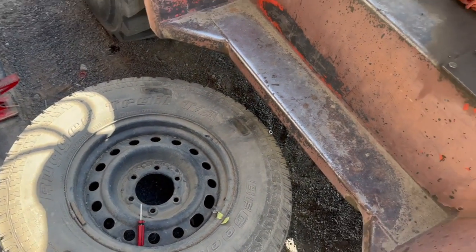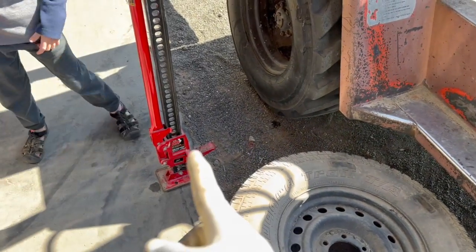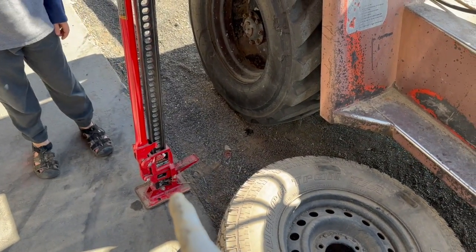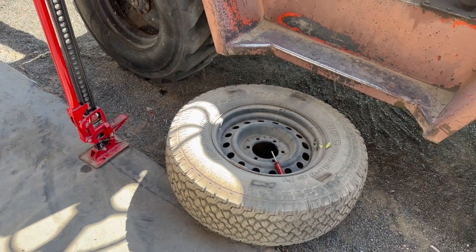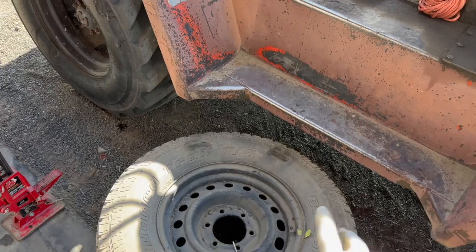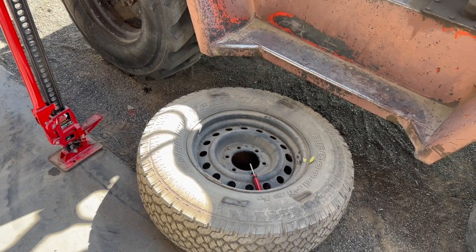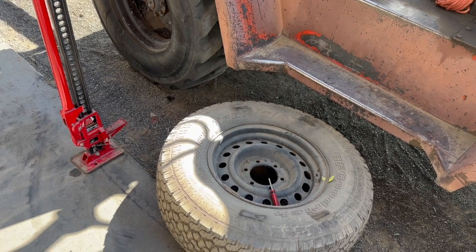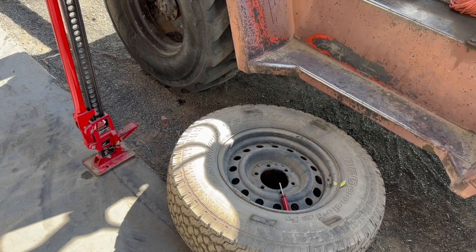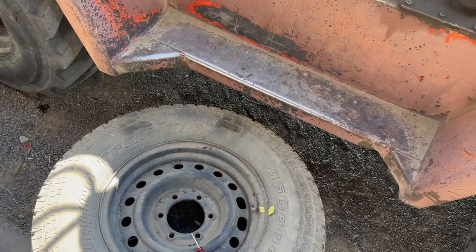For this process I am using a forklift from the farm — a high lift mount — and I'll show you how to use these things. The principle of breaking the bead on the tires is all the same. If you don't have anything like this but you're still trying to save some money, pull all the wheels off your vehicle and just have a tire shop break the beads. Just tell them you want the beads broken, and then you can still do this process right at your own home.